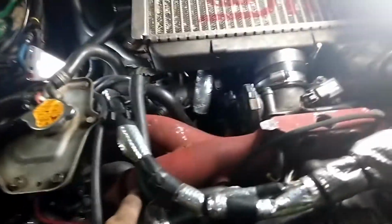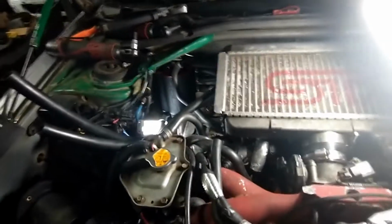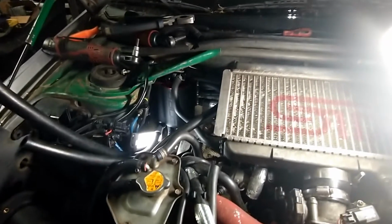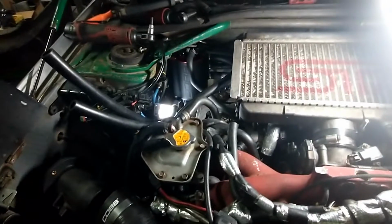Its curvy shape will fit here to go at the top. And the other one we have to do is this other hose that came from the front of the inlet hose and that was going to our intercooler before. This one has to be connected over here, and there's no 5/8 piping in the kit. So one thing you can do is the hose that was going from the PCV on that side to the intercooler, you can also reuse this guy. Actually, it's the one over here. So this guy who was down here like this, over here and coming here.